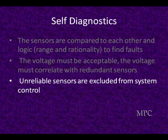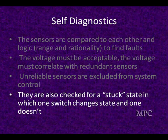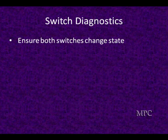Unreliable sensors are excluded from the system control. And if both of these sensors are unreliable, we can no longer control throttle — we have to go to a safety mode. They're also checked to see for a stuck state in which one of the switches will change states and that one doesn't. They're trying to find any combinations — making sure both states change and they both agree.